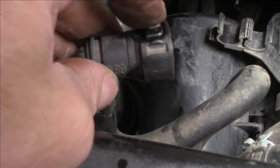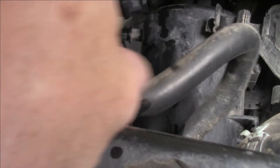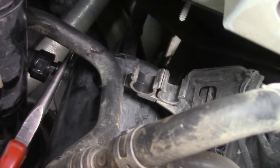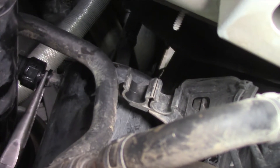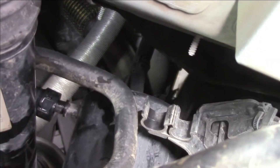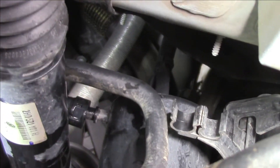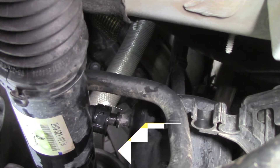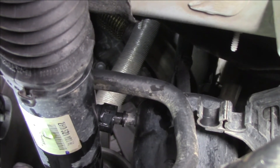Full disclosure, it took me a little while to get it off. I'll give you the heads up on this — these fellows here are a push button, so you push down on this. Because they were so tight, what I ended up doing was getting pointy nose pliers in between here to lever this particular connector off. It was pretty damn tight even though I was pushing down madly on that button. It does take a little while to get it off, but once it's off, it's off. It's just a clip style — push down on that button, wiggle it, jiggle it. Maybe use some pointy nose pliers just to lever gently against it so that it pushes the connector back. Don't reef on it — you may break it off.